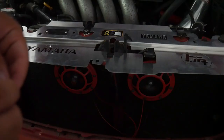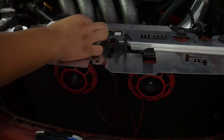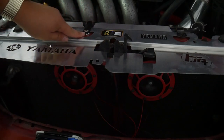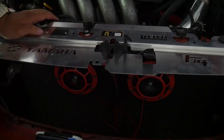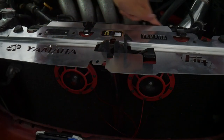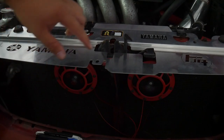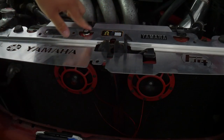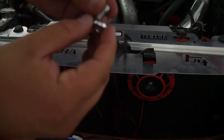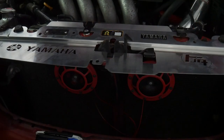The more I look at this spacer, it actually looks like it's meant to go on top of the air injection as a dress-up piece, rather than underneath as a spacer. But looking at how I have it set up, I think this works better for me. When I test fitted with the air injection on top and no spacer underneath, it pushed the cooling panel up on this side, and I don't have a clip there to hold it down. So just know — this is not designed to be a spacer; it's an engine dress-up piece where the bolt goes in flush, but I'm going to use it as a spacer.